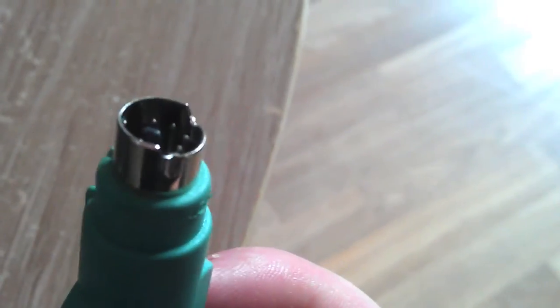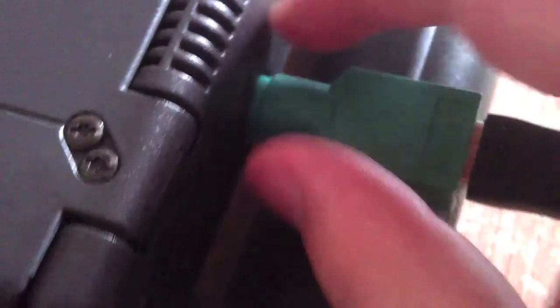So, let's have a wee look at this machine. I'm going to plug in a mouse, because I found that the mouse is easier to work with than the tiny wee trackpad. So let's make sure it's in properly if I plug it in here. My advice to anyone using a computer is, if a PS2 mouse doesn't feel like it's going to go in, don't force it, as you will bend the pins. These pins are really quite fragile and can be quite easily bent out of shape. So just make sure you're lining it up properly, and if it's meant to go in, it will.